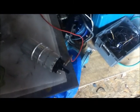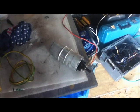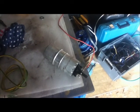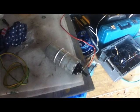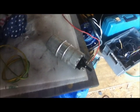So now that I know that the pump works, I've got to find out what it is on the bike that stopped it working. Now you might think, why have you done it in this backwards way? Firstly, I needed to check the pump because that was the obvious thing that wasn't working. When you turned the bike over, you could not hear it firing up. Secondly, when you're riding down the road and it cuts out, and you can hear that the pump isn't working, the first thing you're going to think of is the pump.